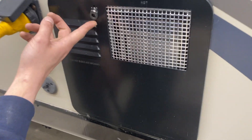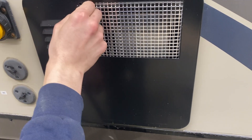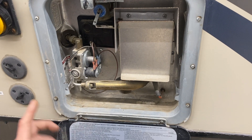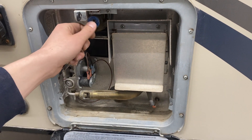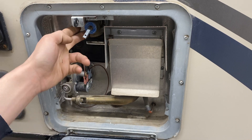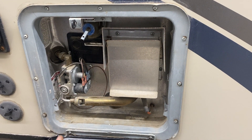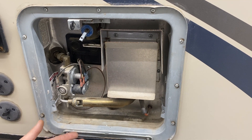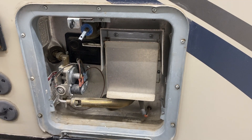A step forward, we're going to find your hot water tank here. Just get that keyway up top, line that up and it'll pop on open. All of your controls for turning it on are just inside the unit. Before you ever turn it on, you just want to hit this relief valve right there. If the tank were full, you'd get a little shot of water out of there, letting you know you are in fact full. We're empty right now because we've got the unit winterized.